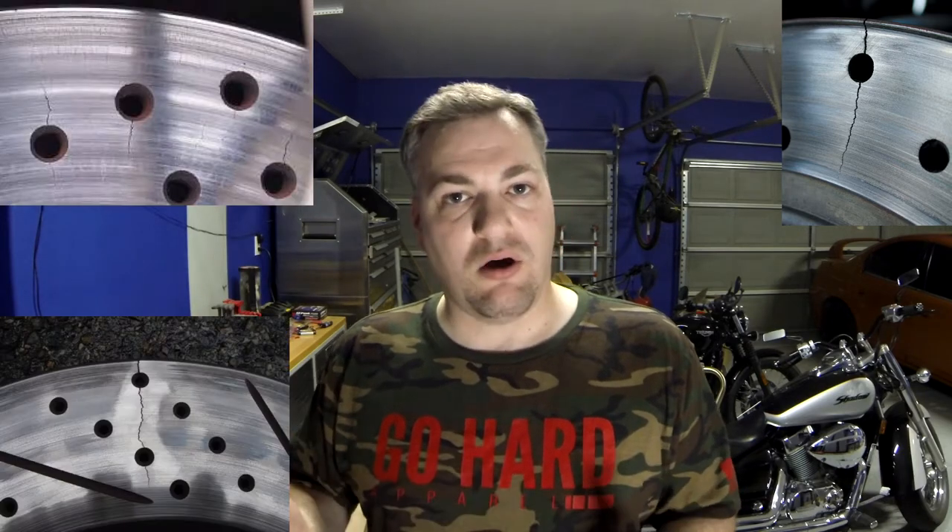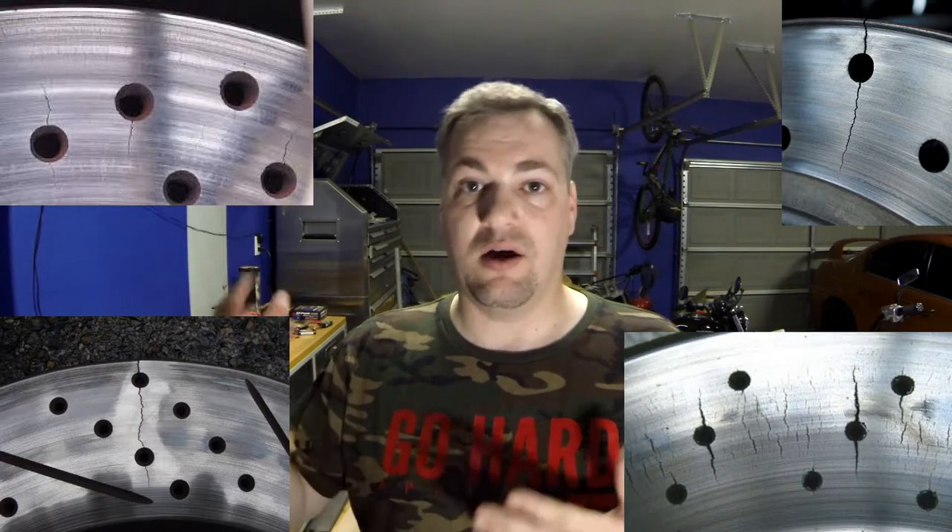You will find with a lot of cheap or low quality brake rotors that are drilled, they tend to crack and they will warp on you. You'll see cars out there like Porsches, Corvettes, higher end vehicles that have drilled brake rotors, but they spend money on engineering. The stuff you get from China is not engineered very well, so you can't really trust that equipment. I would refrain from doing something like that on a lower cost rotor — you kind of get what you pay for, and brakes are one area you really don't want to skimp on.